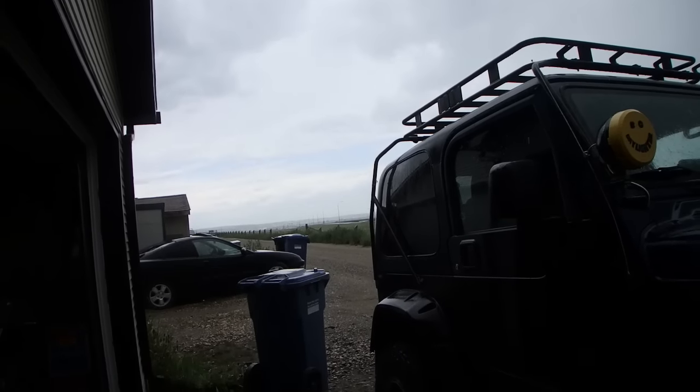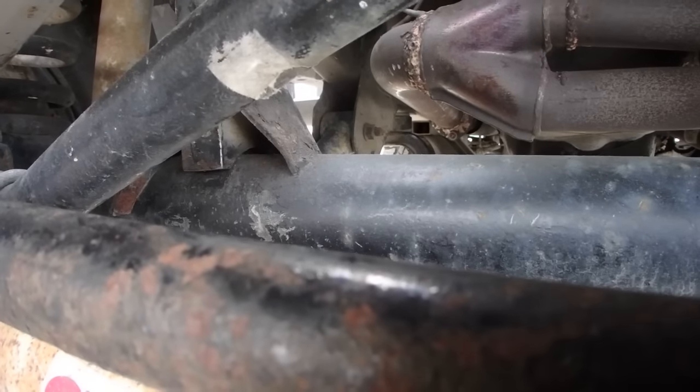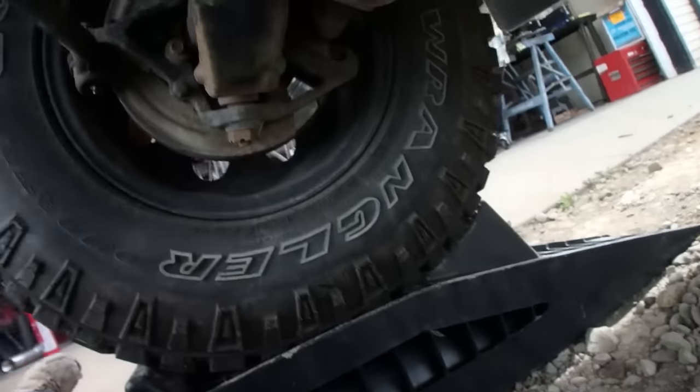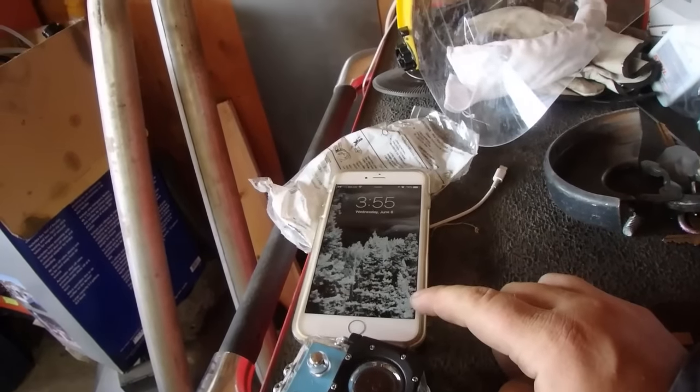That sucker's on there flush now. It was a lot of work because it needed some major modifications — I should have done this right the first time. But I know now it never would have broke because I spent hours trying to break that free and there's no chance in hell that would have ever snapped off the way it was. If you're doing any welding on a vehicle, always remember to disconnect your battery, because there's always a possibility you may fry your computer.